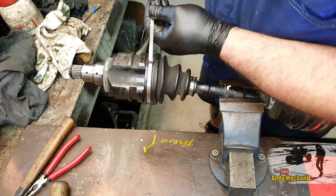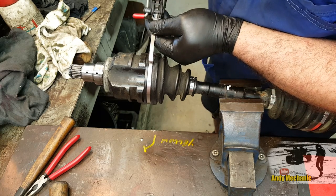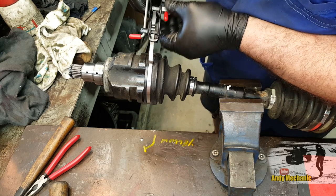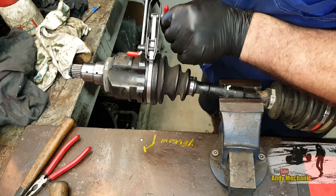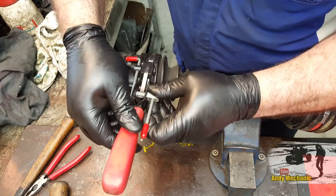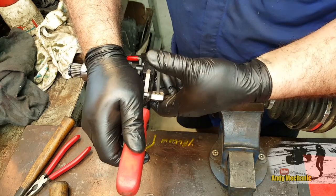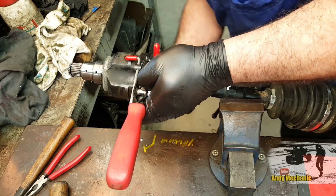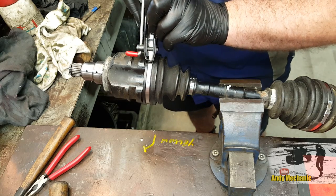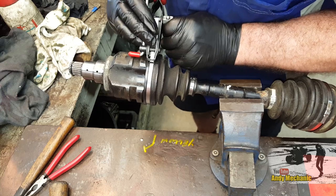Right. So back through the tool again, through the front, through the cutter, down to the drum, align the groove in the drum, feed it through, out through the bottom, take up the tension, roll the tool over so that the band's in the right orientation, tension it up. There we go, nice and tight. Don't over tighten it, obviously. And then when you're ready, bring it back across so that it's almost back on itself, and then we can cut it. So we'll just cut it off now.